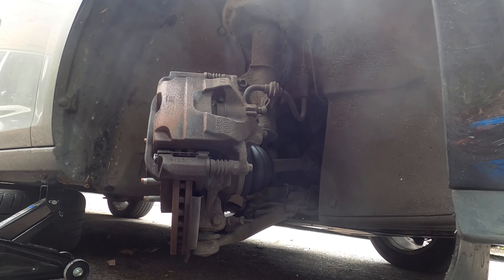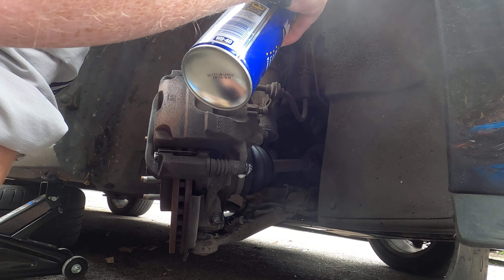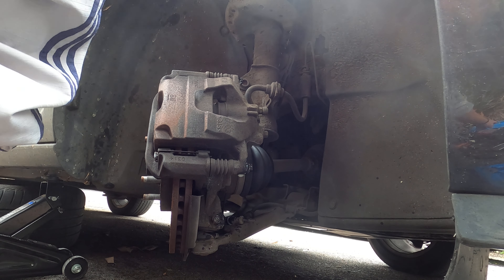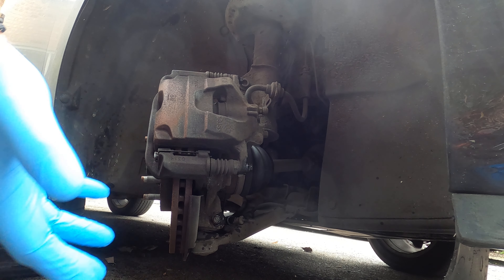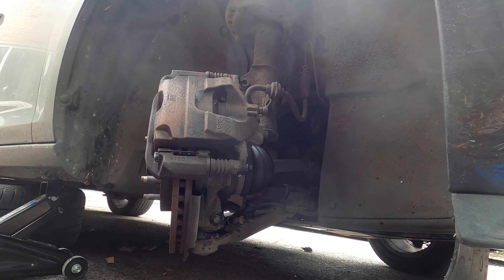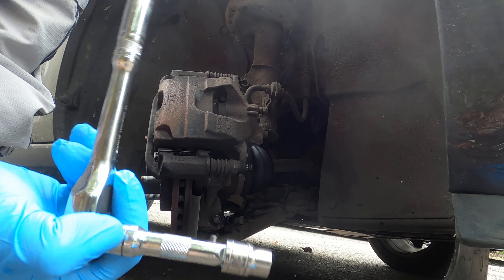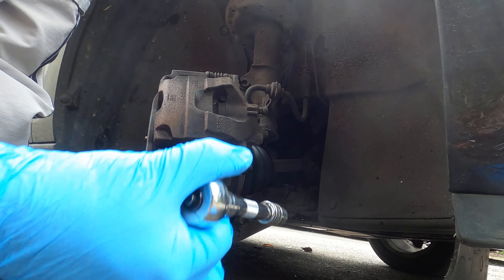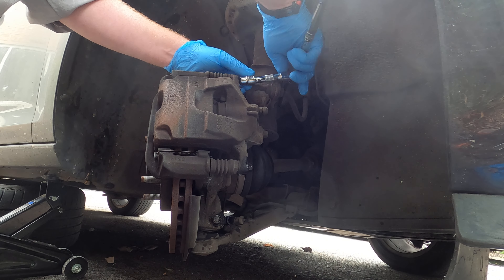What I like to do first is give these bolts a little squirt of WD-40, because they've been on the car for a while and become quite stiff and difficult to come off. Also, get some gloves on. Doing this yourself will save you quite a few quid compared to taking it to a garage. I'm going to be putting on Brembo pads - they were about 60 pounds when I got them this morning. You'll need a 10mm socket to undo these two fixings. Make sure your ratchet is set to lefty-loosey, get them on the fixtures and crack them off.